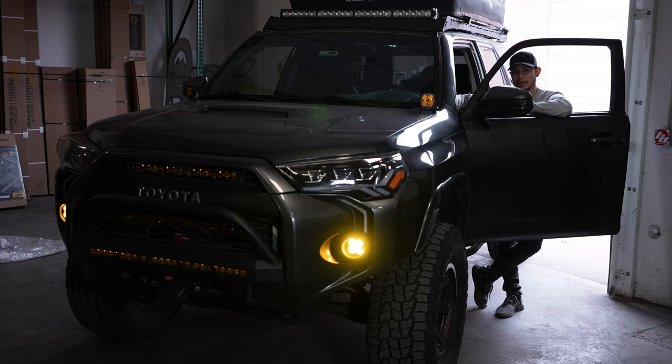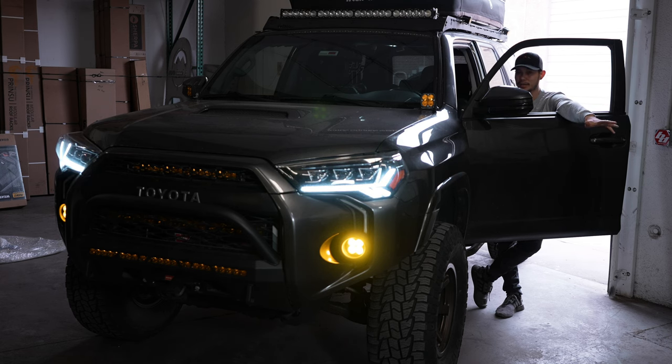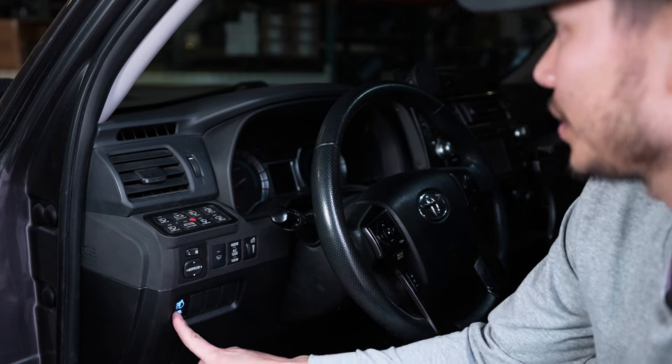The cool thing is you can turn your headlights all the way off and still be able to turn your fog lights on and off whenever you want. This really comes in handy when you're driving with a ton of snow coming down and you don't want to use your low beams, because white light tends to create more of a blinding effect. What I would do is put it in marker light mode, or side marker mode — you still have the headlights visible so cars can see you, the tail lights are still on, and you have the fog lights to guide you.